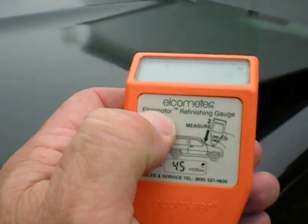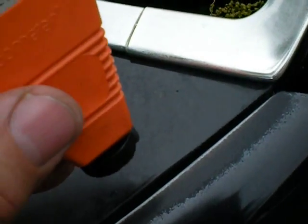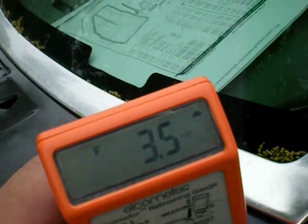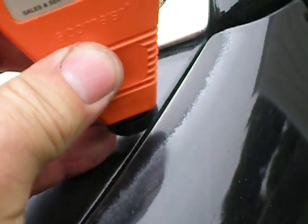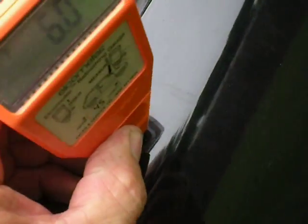Let's push this little button over here. As you can see here, the clear coat's burned out, there's some base coat primer showing. Stick this down — 3.5 mils. Come over here — 8, 8s, generally about as high as you'll see on the factory paint. There's a 6.